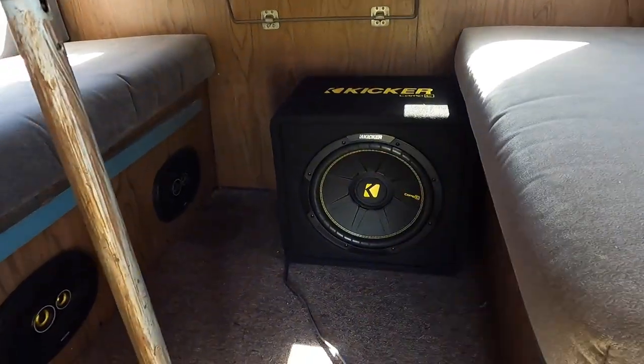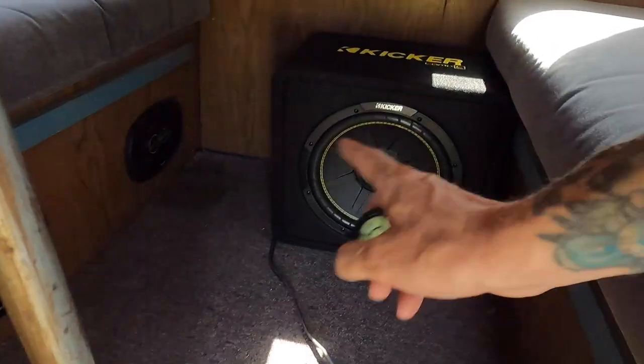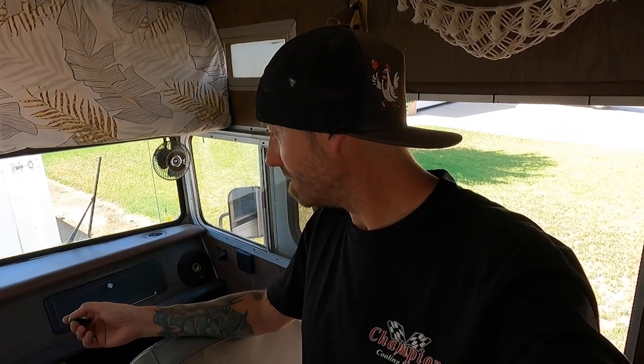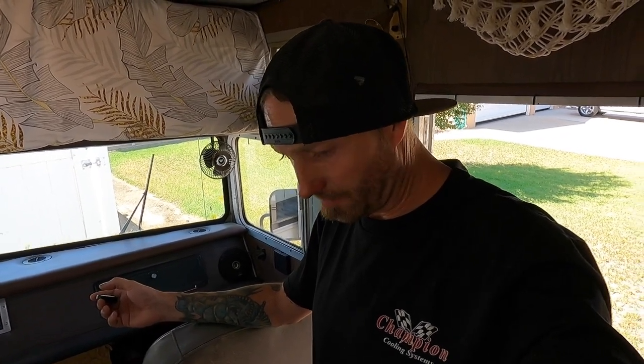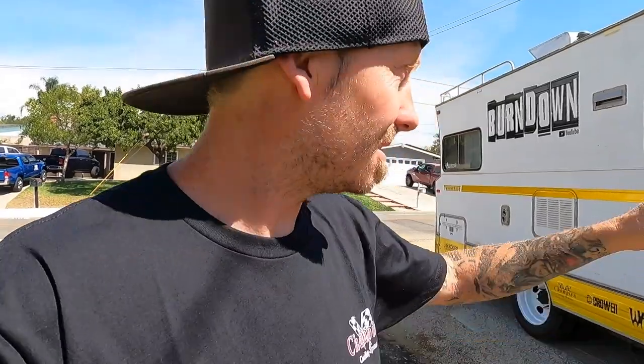I ran the second sub. The cool thing is the amp has two outputs but it's a mono block, so running them in parallel is going to make these two ohm instead of four ohm because there are two of them. This is the original idea — facing the door, tucked underneath — but you can see it takes up a lot of footwell room. Let me show you what it sounds like. We queued up YouTube-friendly music. It definitely projects better from there and brings the bass more front and center.